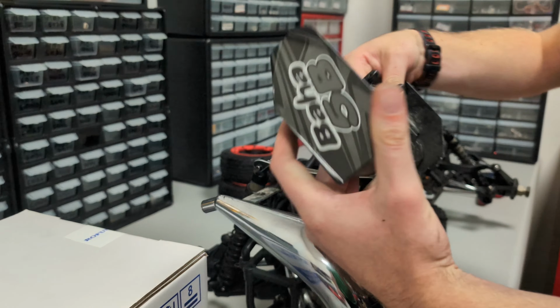We're gonna start taking these side covers off. So there's a little pin here on the side that just takes this off. And the other side, there's one on the other side. Done. And then we have some bolts. So there's one bolt here on the engine. Take this off. Alright, so that's good.